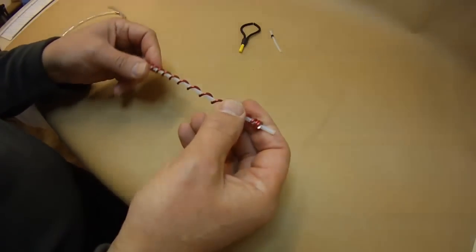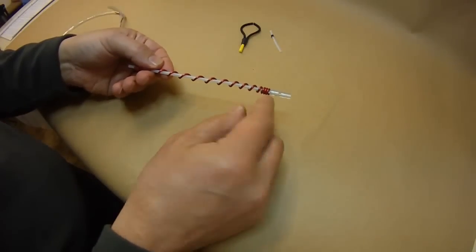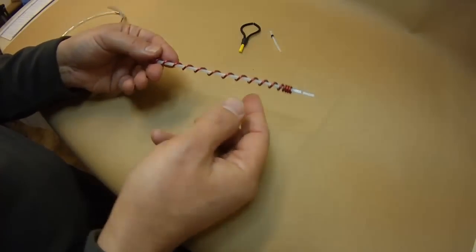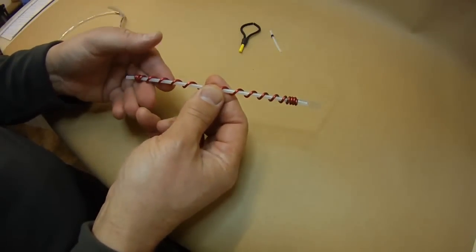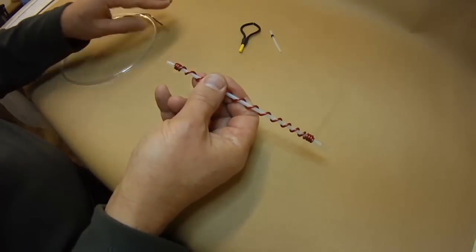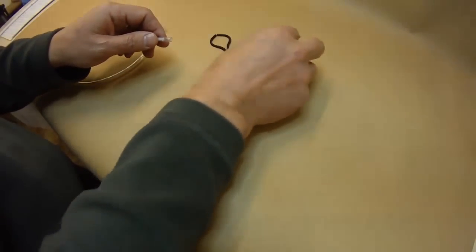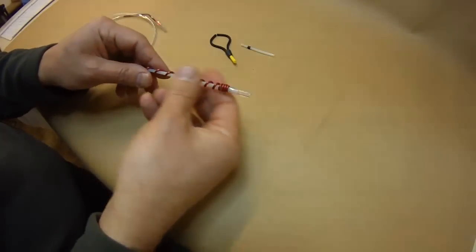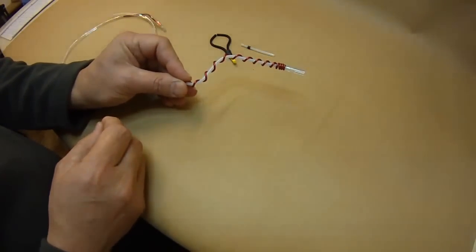The third thing we're going to be covering is the Tutoro helix. This is a semi-rigid plastic pipe with a spiral-wound aluminium around it which allows you to place it in position. This end goes into the oil feed pipe, and this end takes either the twin feed nozzle or the single feed nozzle. Once in position it can be moved and set.